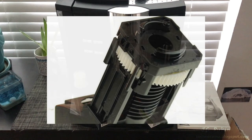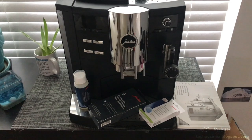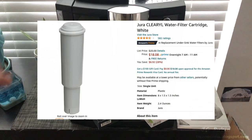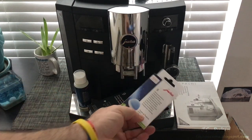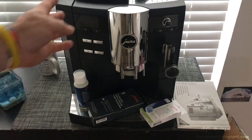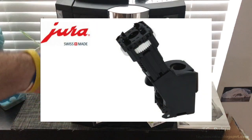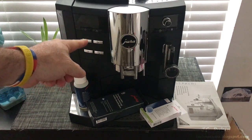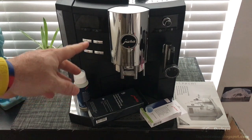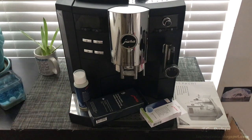All the inner mechanisms, aside from the cleaning agents I have here, include a water reservoir with an internal filter that I also fill with filtered water. We use cleaning tablets on a regular basis that clean out the system — the mechanical parts that contact the beans, grind them, and press them down. Over time there's an accumulation that gums up the works, becomes problematic, and the machine needs to be completely disassembled in order to get it working like new again.